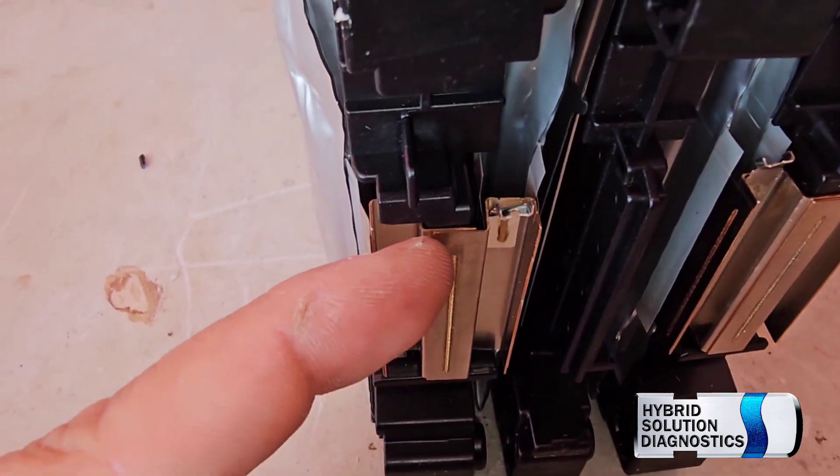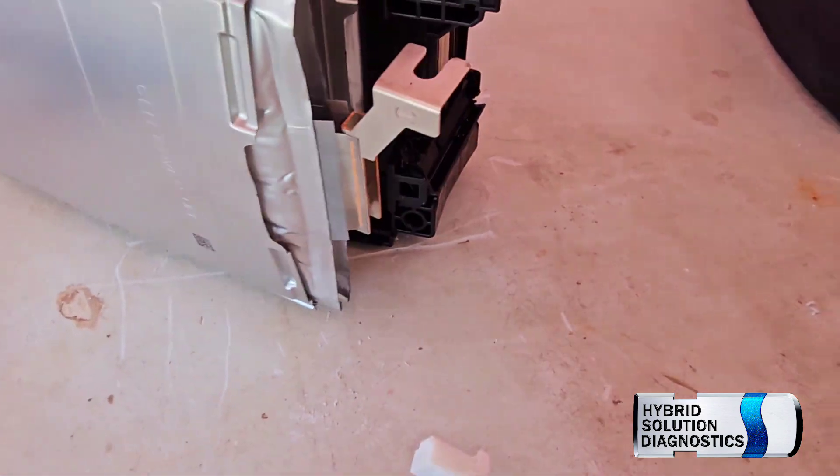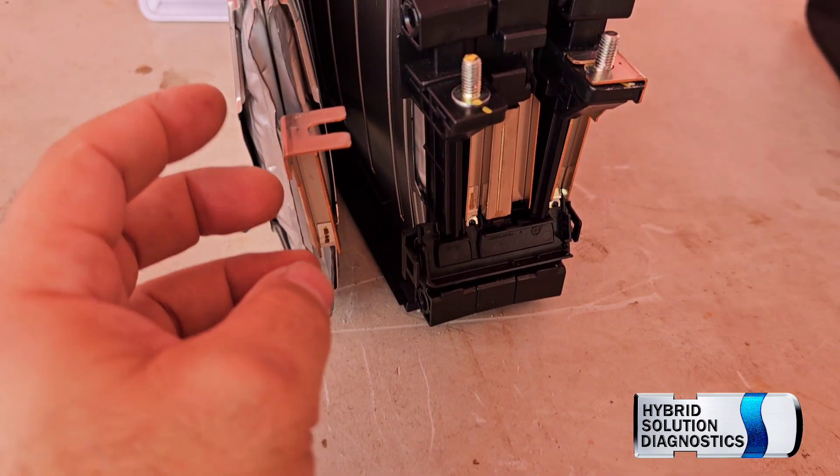So we finally get — usually it's about 13.5V — considered that lithium cells have a source voltage a little higher than nickel metal hydride and of course lead acid batteries. As you can see, I need to remove the bus bars that connect these cells, but take a look — these bus bars are welded. So I'm going to need to open them to finally remove this battery. One thing you need to be aware — please don't do this at home. I'm taking extremely careful precautions because you don't know what's going to happen with swollen lithium cells. This is just for educational purposes. Let me finish to open this battery and disconnect the bus bars from the cell to show you the structure of the integrated 12-volt battery of Hyundai IONIQ and Kia Niro.